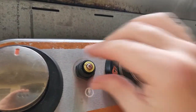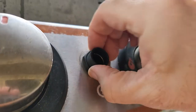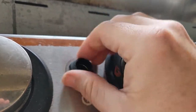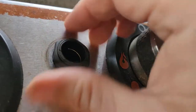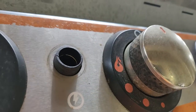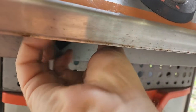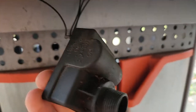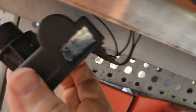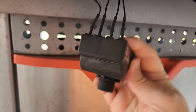We're going to have to change out this igniter. It's pretty easy. Take the battery back out, and then there's this little nut that holds the igniter in place — we're just going to unscrew that. Then we reach underneath and pull the igniter out. I recommend checking there's no critters, spiders, or anything like that under there. My grill's a four-burner grill, so that's why there's four wires connected to the back.